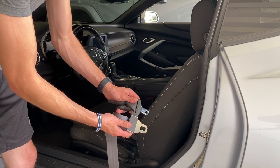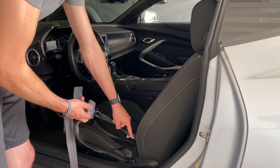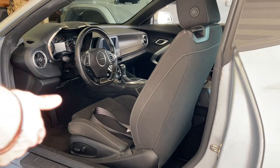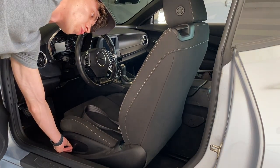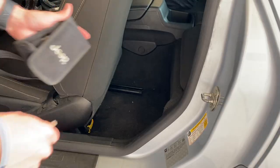So I'm going to go ahead and unbolt the rear part where the actual seats are mounted, then slide these brackets down and bolt it on top. To get access to these you will want to raise your seat up all the way and push it forward all the way too — that'll just give you a lot more room to work with. It's only two bolts in the back on each side, so it's not too bad at all.